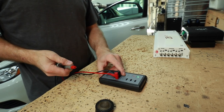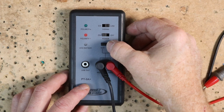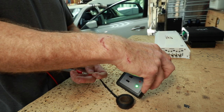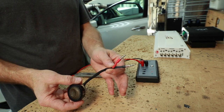One of the most helpful things this tool does is test polarity on tweeters. Tweeters are tough — you don't want to take a battery and try to pop one. This is where it really shines. With it set up the same way as before — line, on, and out — take the test leads and connect to the tweeter. It's tapping red, so flip them, and now we have green. We know which side is positive, which is negative, and we can apply our heat shrink.